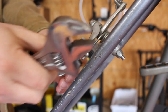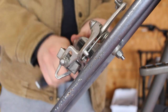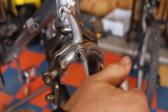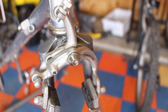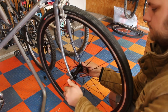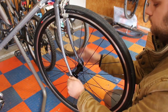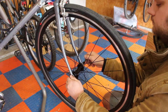For the stock brakes, I was lucky — the brake arms had enough reach so I could adjust the pads all the way down and they would work with the 700c rim. Since 700c wheels are slightly smaller in diameter than the original 27-inch wheels, on some conversions your OEM brakes won't reach the rim braking surface and you'd have to replace them with long-reach brakes. But these Bridgestone self-centering side-pull brakes had enough reach in the brake arms for me to just move the pads down and they worked with the rim.